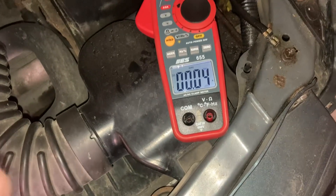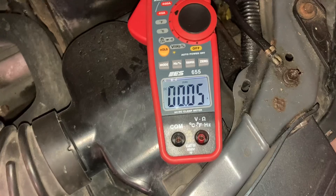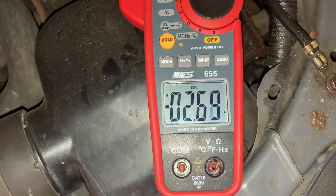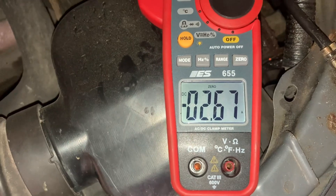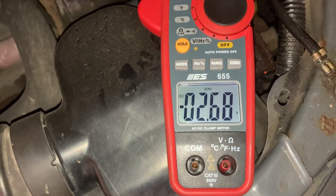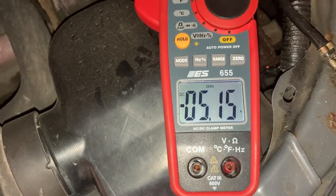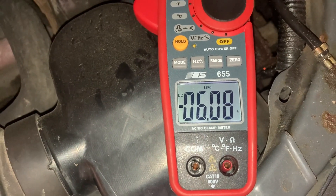Some of the stuff is not so obvious. Turn on one of the seat heaters, Stevie. There's the draw on the seat heater — those are operating at about 30 watts. Turn on the other seat heater, Stevie — it should double, and it doubles. So both seat heaters are actually operative.